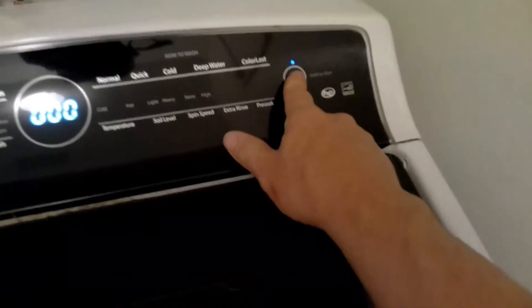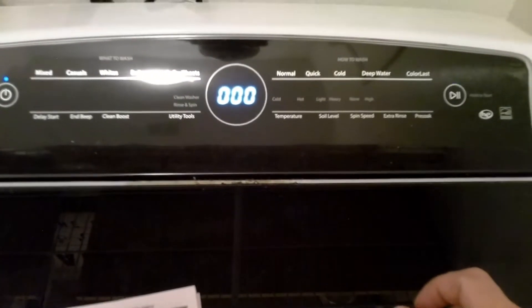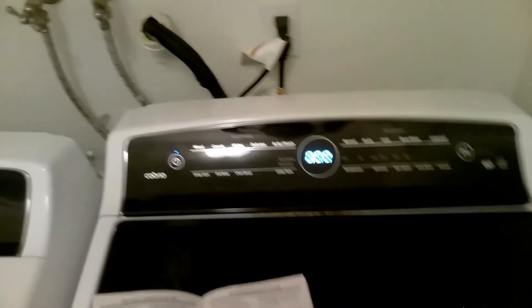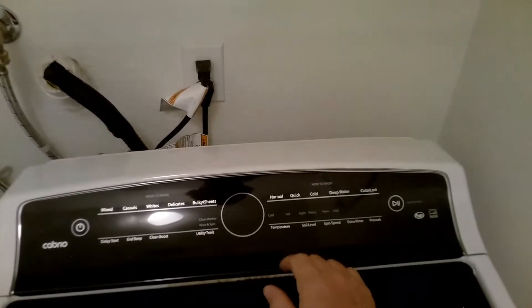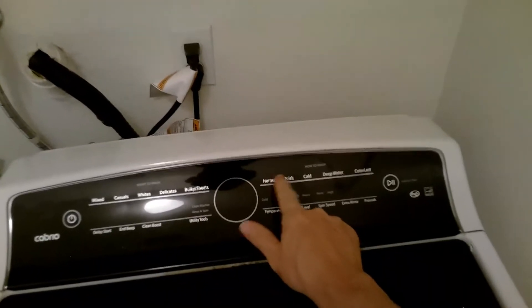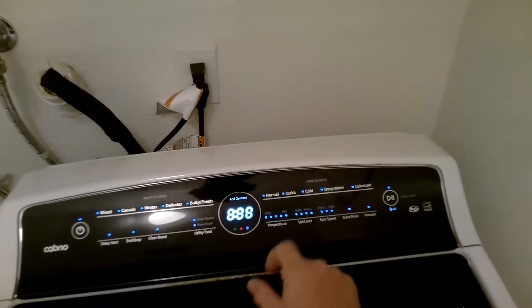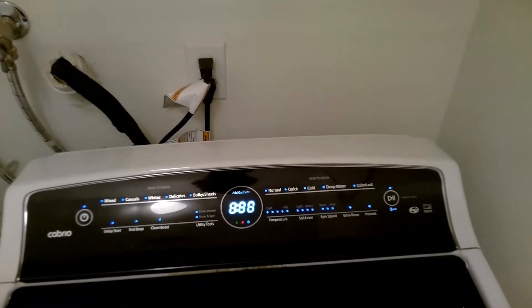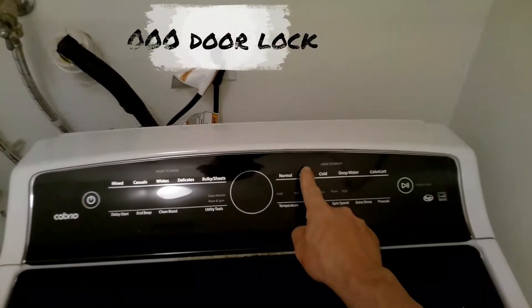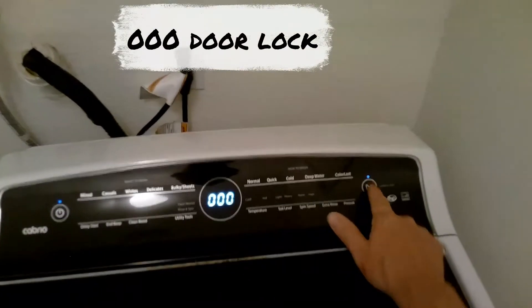What I have to do is actually go out of diagnostic mode and turn the machine off. So I turn the machine off and place it back into diagnostic mode. Quick button once — it will display an error code and I hit the Quick button again.